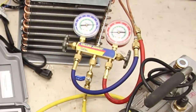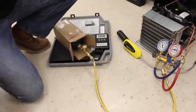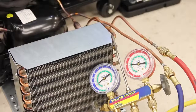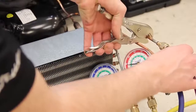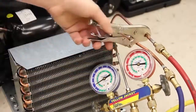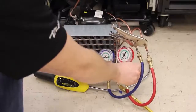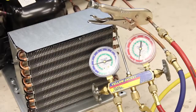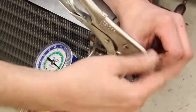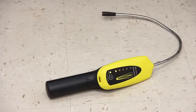Allow the unit to run to verify operation. It is now time to remove both your hoses and temporary access valves. True requires the removal of any access valves on any refrigeration system. The next step is to remove the refrigerant trapped in the high side hose to ensure the proper charge in the unit. To do this, pinch off the high side process tube in front of the access port. Next, open the high side valve, then slowly open the low side manifold valve to draw all the refrigerant out of the high side hose. Once the pressures have equalized, close the high and low side manifolds. Using a tubing cutter, cut the high side process line in front of the temporary access valve and behind the pinch-off tool. This could cause the combustible leak detector to go off — wait for it to level off before moving on.